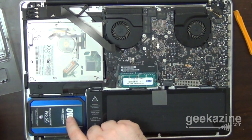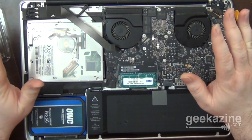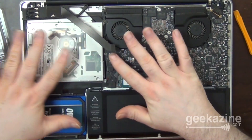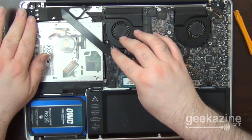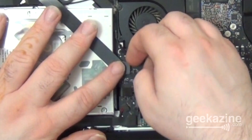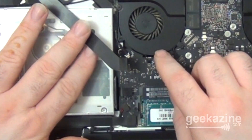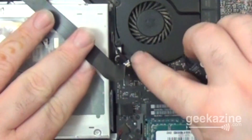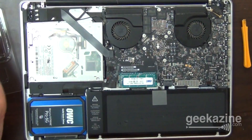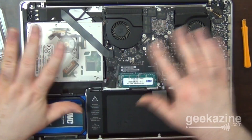All right, so now we're back inside our MacBook. As you can see, we have our SSD drive and the memory right there. We do want to ground ourselves, so touch metal so you don't get any electric shocks if you have carpeting or it's a dry time of the season. The first thing you want to do is make sure that all the cables are handled — this cable was sitting flat, and then we had a cable right here which actually went to the DVD drive. That needed to be pried off. It's really straightforward. All you have to do is take your fingernail and work it back and forth, walk it out nice and slowly so it doesn't lose its connection. There was another very small cable right here where I had to pull out because there was a screw down there. In the early 2011 model, I had to pull this one out and this one out. In some cases you might have to pull the cable that goes to the hard drive, but I didn't have to do that.